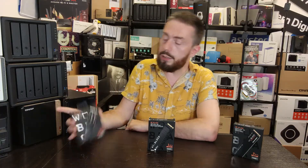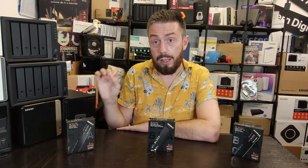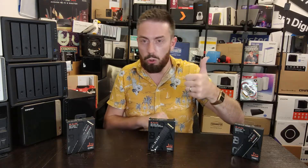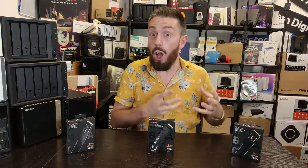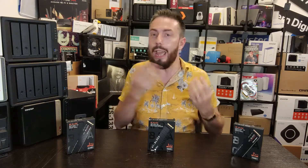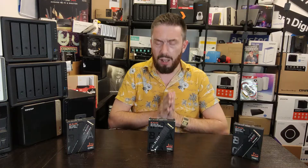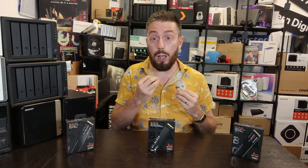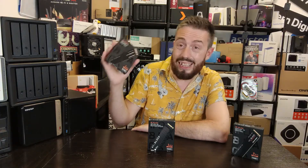Another big difference between these drives comes down to efficiency. One reason the SN770 exists is because it is DRAMless. An SSD isn't unlike a computer — the controller is kind of the brain (like a CPU), the NAND is where your data lives (like a hard drive), but SSDs also have onboard DRAM memory, which is basically the juggling area of the SSD to work out its tables and help process data. That can increase price, and more memory means more scratch area, but it also increases power consumption.